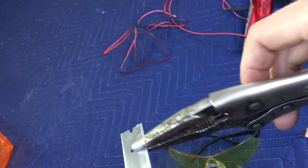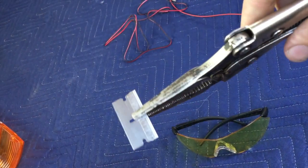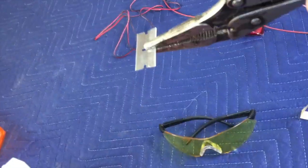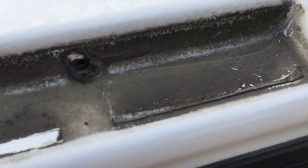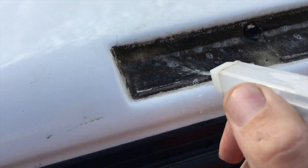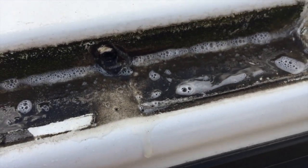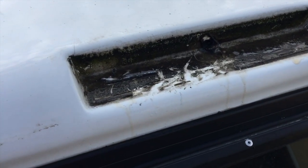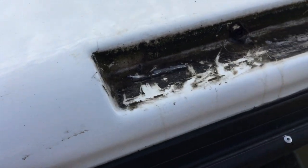What I do with the razor and the needle nose is fix them real tight together so we have a strong grip with lots of leverage — we can clean that off real good. First, we're going to spray the degreaser down. Look at how nasty that is! We're going to spray it and let it soak in for 5 to 10 minutes, letting it penetrate and get all the nastiness out of there. Then you're going to take your razor and get off all the old 3M tape.